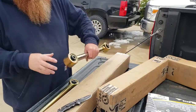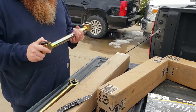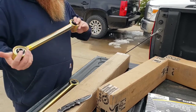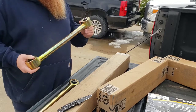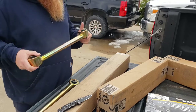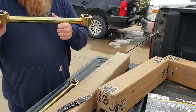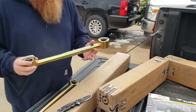Okay, and the bushings are kind of unique. They're a DuPont Kevlar hybrid with vulcanized rubber bushing. They're pretty cool. They allow a lot of freedom of movement and have a natural return to center, so you're not going to have control arms sitting sideways all the time making noise, as you might with some of the other kinds. They are offset, so you can run a wider tire with less backspacing.